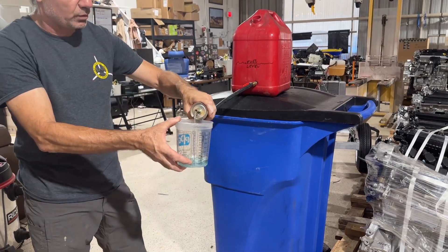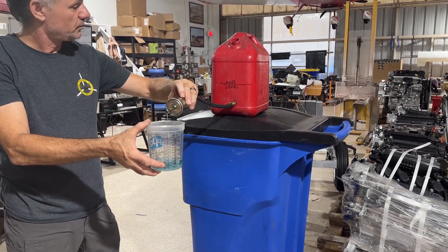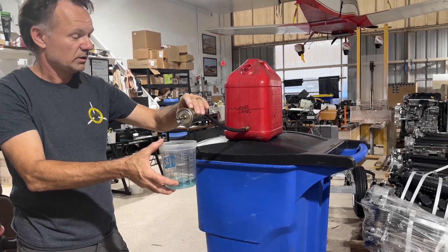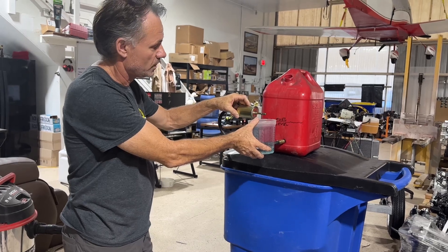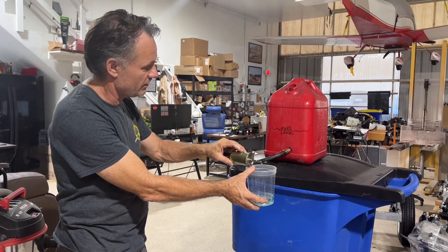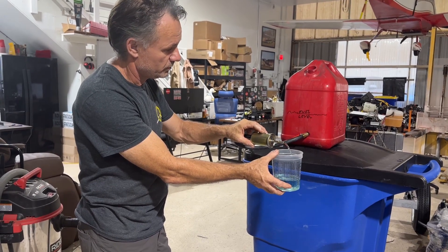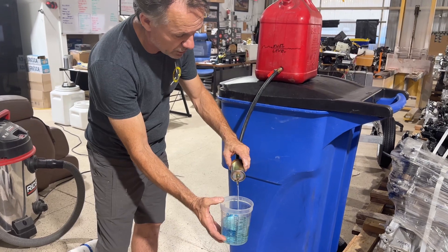Now, what if the hose is above the fuel tank level — goes up a little bit — but the filter itself is level? That's also not a good idea. We're almost at the level of the fuel; we're up by the fuel level and we can't run uphill. Just go down. As soon as we are at the fuel level or below, and the filter is level, we're getting fuel. The lower and more level we can bring it, clearly the better — by a huge margin.